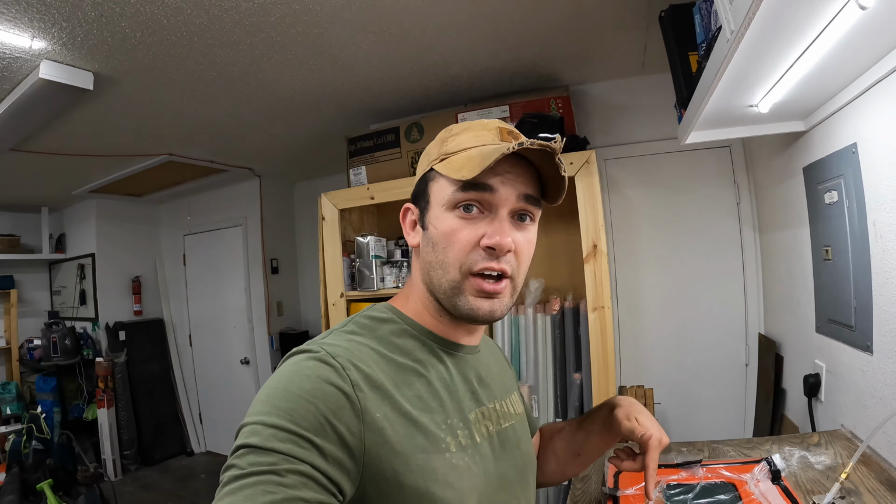You're gonna want some gloves, very important. You're also going to want a mask because you should not be breathing anything that has to do with carbon. And some glasses, extra pieces for your Dremel, a drill bit to start some of these holes, a vacuum, because once again, you can't stress this enough, you do not want to breathe anything coming off of these, whether that be the plastic from the epoxy or the carbon. The carbon is akin to asbestos in your lungs. So yeah, wear a mask, wear a respirator. With that being said, we're gonna cut these things out.